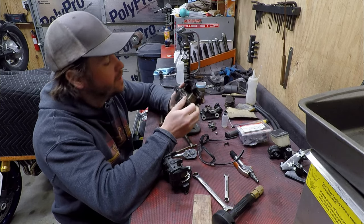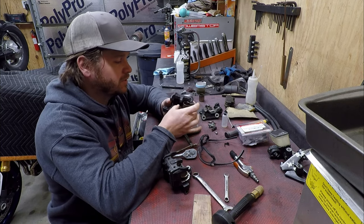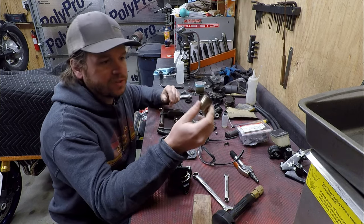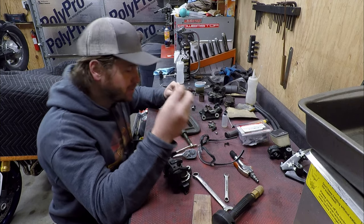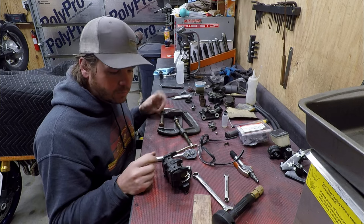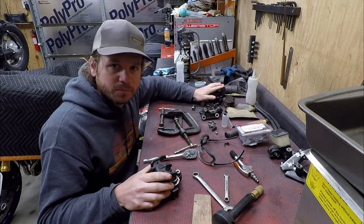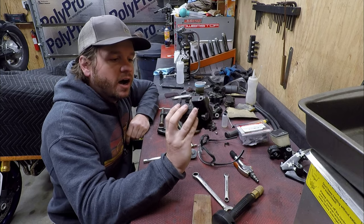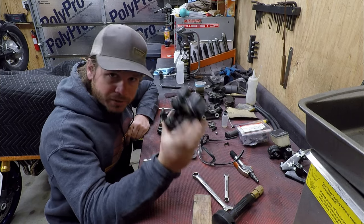And when they're in there, a lot of times you'll have maybe just a little bit of an overhang to where you can't really wiggle these things out. And they just become a big problem. You don't want to use a set of vice grips or anything like that or channel locks on these things because you're going to damage the piston. And even though you could replace those, there's just a better way of getting those out of the caliper without hurting them. So I've already got one set loose and these things were a complete bear to do, and we're going to go ahead and move to this side and figure out what it's going to take to get these things out.